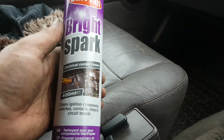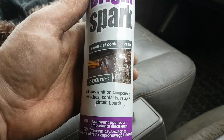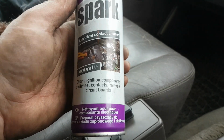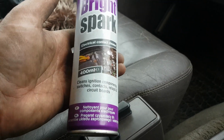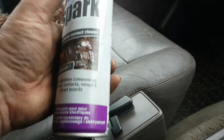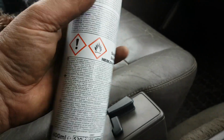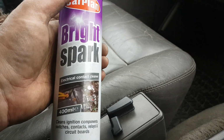This is not sponsored by Carplan Bright Spark, but it's just the product I use. I'm sure there's plenty of other stuff around, but this specifically is an electrical contact cleaner. It cleans ignition components, switches, contacts, relay circuit boards. If you've got a switch that's playing up, it's quite good to give it a good old jet of this stuff in first of all, because it tends to melt, dissolve the crud that builds up on the contacts.